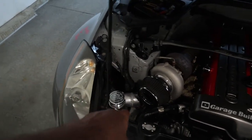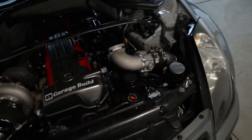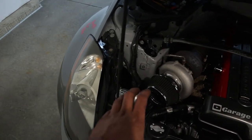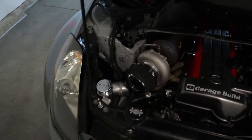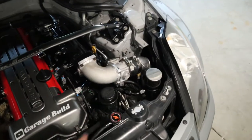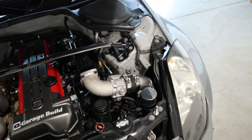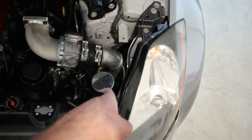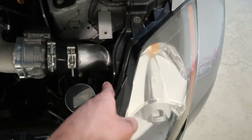This side barely touches — it's the other one that's the real problem. With a five millimeter spacer on the wheel and this thing slightly rotated I think it's gonna work fine. Over here we're just gonna have to finesse it — put a spacer on, cut it, scoot it in a little bit. But first we're gonna measure the distance it's allowed to be moved. I'm gonna order two five millimeter spacers from Z1 and a dash-10 180-degree AN fitting.